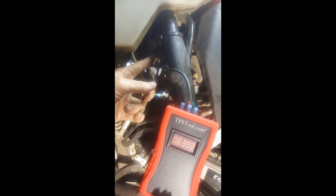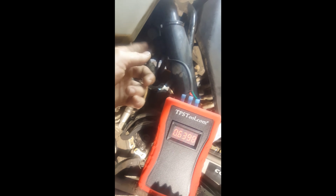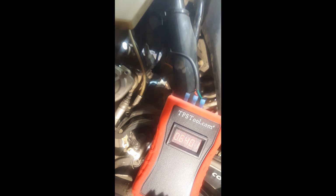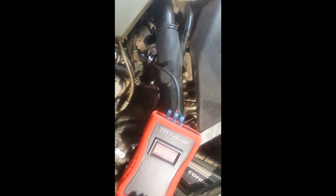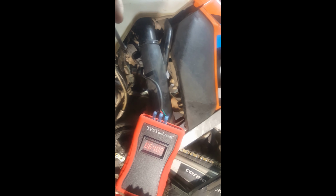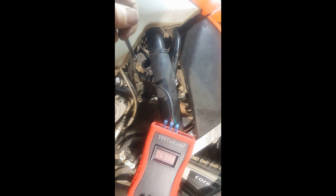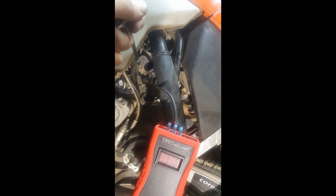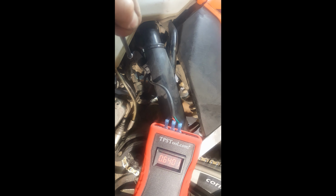And you can see it just to barely touch it and it changes. So there I have it at 0.6401. Tighten it. And you'll see when I touch it with the wrench, it changes just ever so slightly. And there you go, 0.6401.